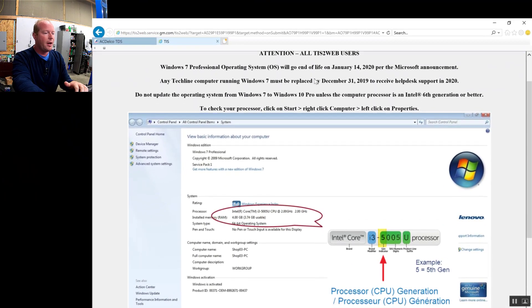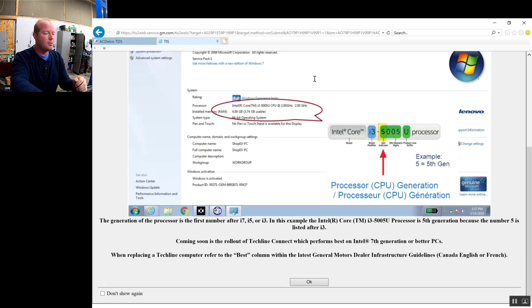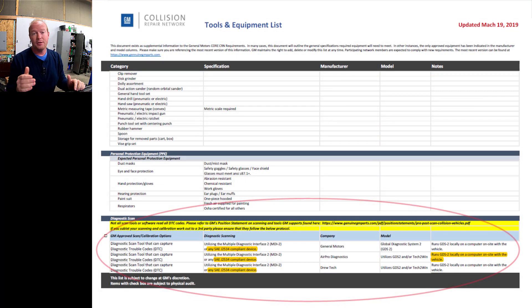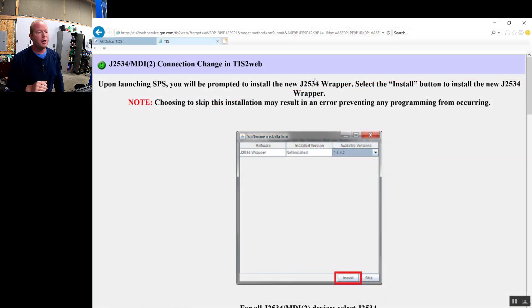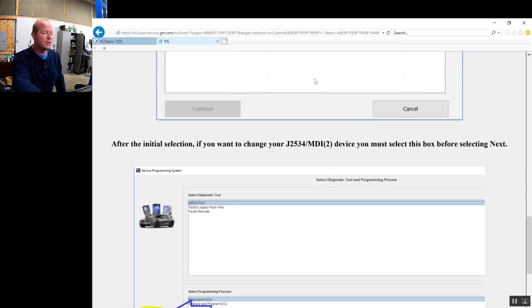It's going to give us some information about what systems we need to run — Windows 7 was operational until January 14th, 2020, and anything after that needs to be Windows 10. The computer requirements include i5, i7, or i3. This computer is an i7, so we have no issue there. This is a new process from GM as of about September/October to be able to use an aftermarket J2534 device. According to GM, any J2534 device that meets the J2534 protocol can be used with a GM vehicle — it does not have to be OE or on their approved list. There are just so many J-Boxes out there, they can't approve them all. This is their new process to select your J-Box.